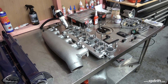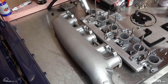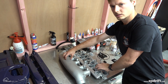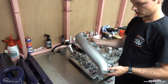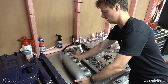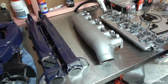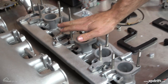In terms of this intake manifold here — what have you actually done to this RB26 intake manifold? It's a factory one but it looks really awesome. Basically we shaved off the original mounting points for the linkage bridge where the cable usually goes, since it's not needed anymore. We then replicated the cast look as best we could and had it vapor blasted — it gives it a really nice finish. You can barely tell the difference from the OEM setup. It looks really factory once it's assembled.